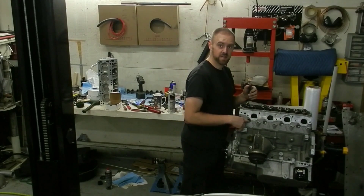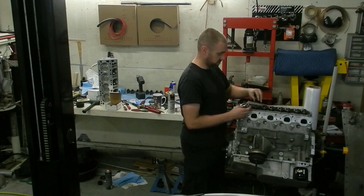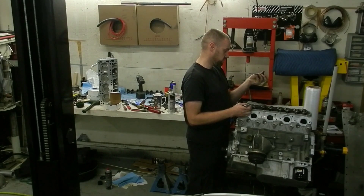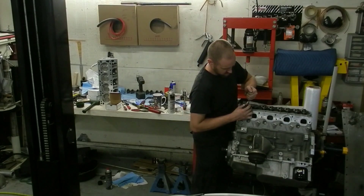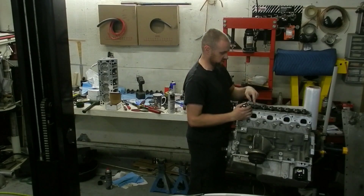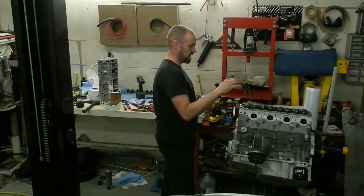All right, so I have the piston at top dead center — it's on overlap. I collapsed the lifter to verify how much the lifter is collapsed; I'll calculate the number in a little bit with my caliper. So this is the intake valve. I'm using an alignment tool — it doesn't really matter what I'm using, but this area is strong enough that I can push on it and get enough leverage to collapse the spring. And I feel zero things hitting within that amount, and that's easily a hundred thousandths. So that one I know is good, and that one is also good. I have way more than enough valve clearance — there's no way this thing's going to have an interference issue on that part of it.